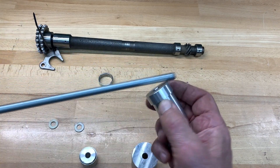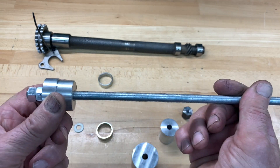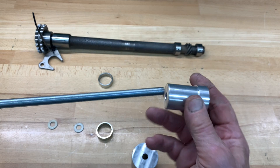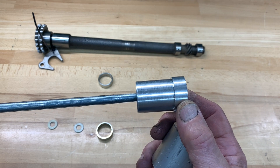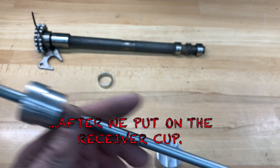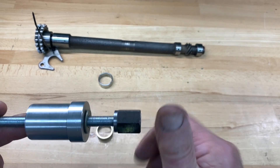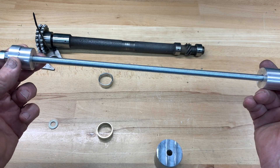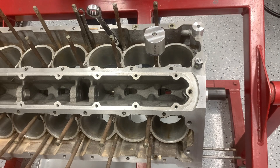The way this thing goes together: we take our small driver, put it on the shaft with the bushing — or if we're going to use it to remove the old bushings, we simply install it in position to do that. The cup goes on to stabilize the lead screw so that it goes through straight. Then we put the grade 8 washers on both ends — so that the nut doesn't gall into the aluminum. As we tighten it up, the two drivers get closer together, and the theory is it's going to drive the old bushing out. We can also use the same setup to install the bushings. Truth is, I haven't actually done this yet — I'm assuming this is going to work. Let's see what happens.